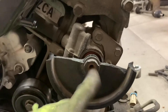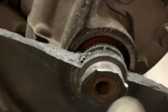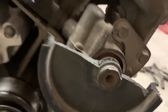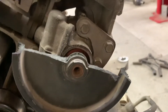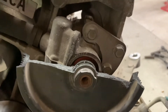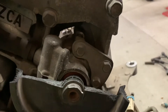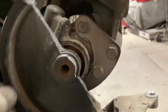Sure enough, that made really quick work of the pulley, and it is plastic. You can see how it's molded onto the splines here for the little metal piece that pushes onto the shaft itself, so there's just no way to get to it. The gear puller just cracked it in a couple of cranks and it came right apart. But it gives me enough access to get to the four bolts that hold the power steering pump in place along with the bracket that I need. I'll rotate that around — there's my fourth one on the bottom — and get that out of there.